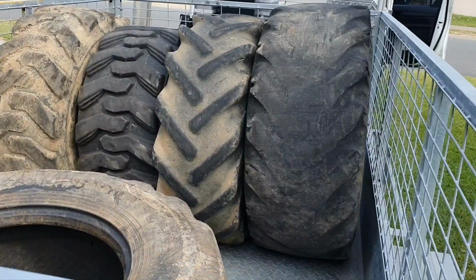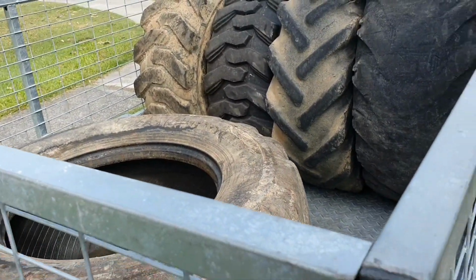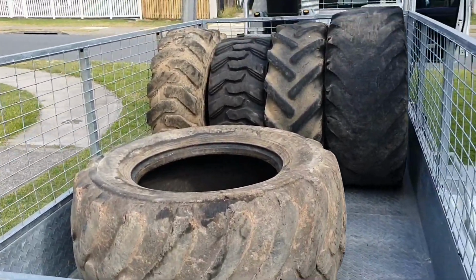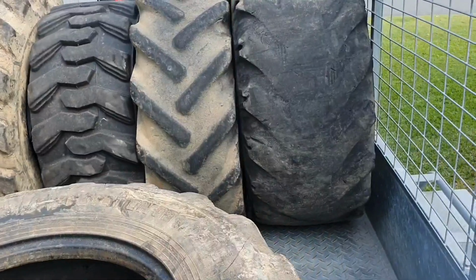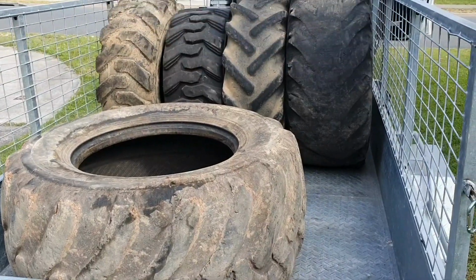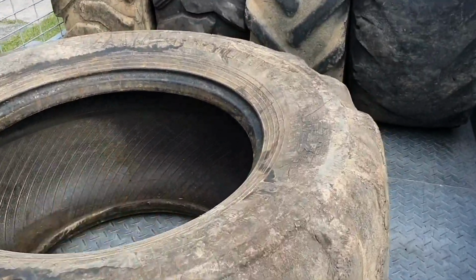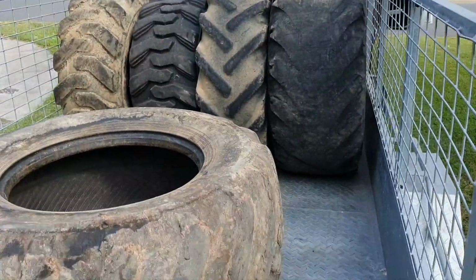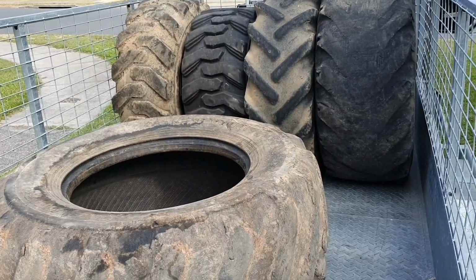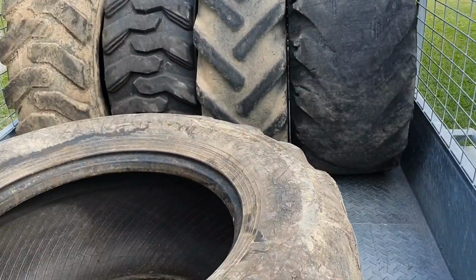Just picked up some tyres, just as a safety precaution in case the boat does fall. It lands on tyres rather than concrete. I got the biggest height possible. I got the console, which will be above the actual hull itself, so they're going to be sitting on these. All the weight is going to be on these while I'm sanding and painting. So it should be probably 2 high, 2 down the back and 2 on the bow, and it should be enough height to get the console not to hit the concrete.